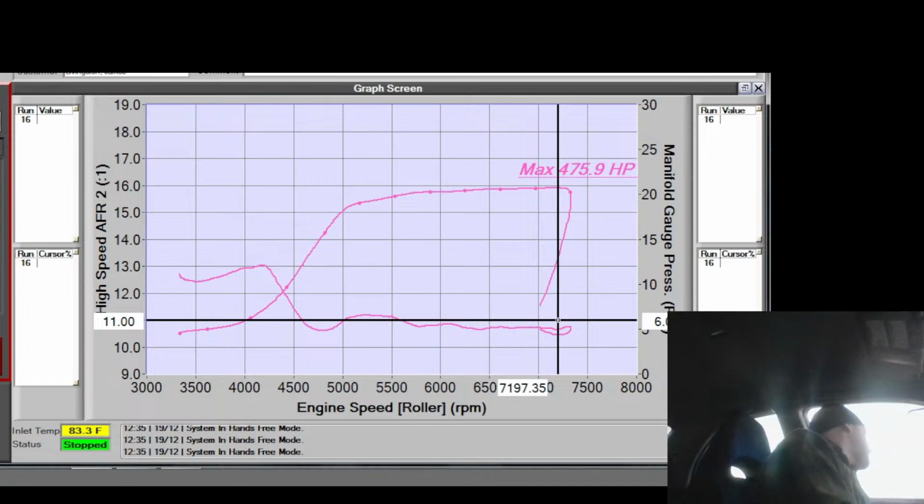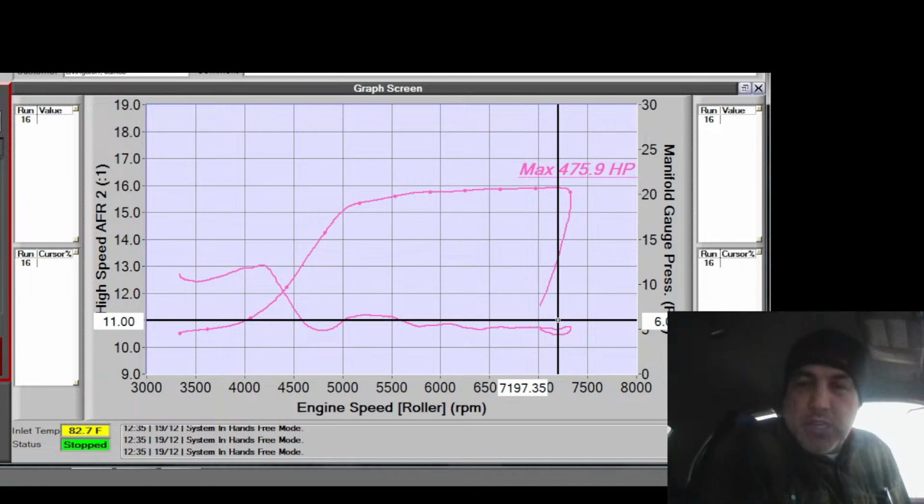Gas gauge says less than a quarter now. I think we're in good shape. It could go better, Mark. We have some struggles with cam timing and ignition advance, and I forgot to raise the knock threshold to compensate for the piston slap of the loud forged motor combined with solid engine mounts. So I raised that a little bit. That was all it took, really just a tiny bit, and it cleaned right up.